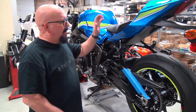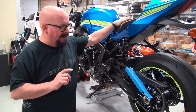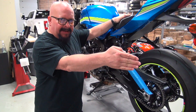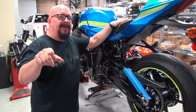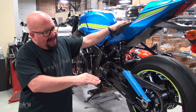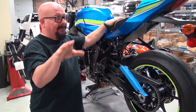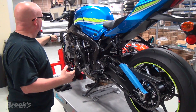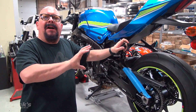Why is this attack angle important? On a sport bike like this, as opposed to standard bikes in the past, what they're basically trying to do is apply more power to the rear wheel, which will accelerate the bike. The intention is also to help keep the front end down, because if you squat too much - sometimes you need squat, but too much squat will cause it to unload the front end. On today's sport bikes, because this is lower, when power is applied the bike actually raises up as you're giving it power. That helps push the tire into the track and helps promote weight transfer.